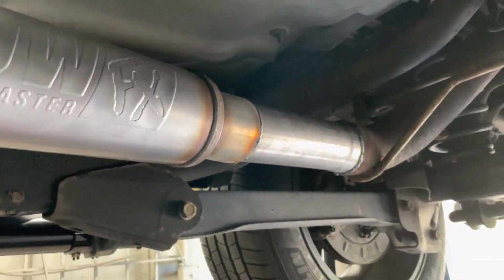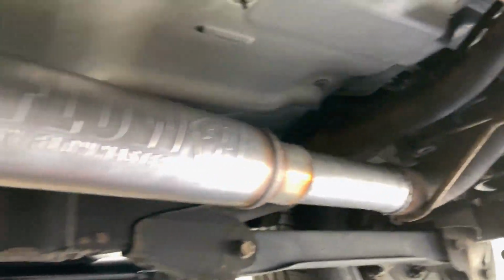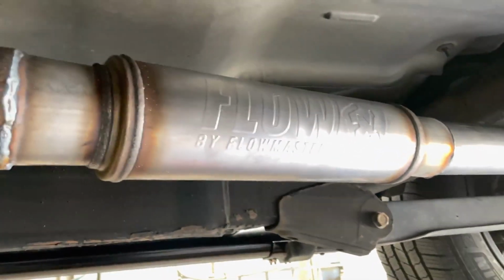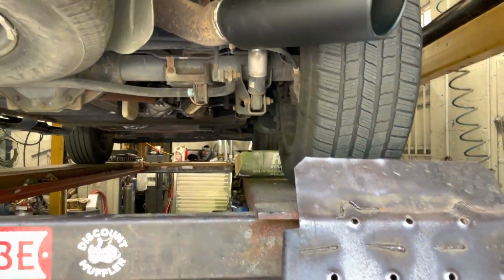We always have to add a little piece in there because that muffler is gigantic over there. And always recommend that you do a tune on it to get the 4-cylinder mode taken out, because it will drone if you don't. And there'll be a link in the description for the tip and the Flow FX.